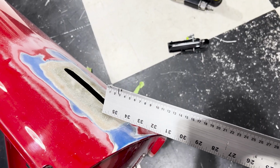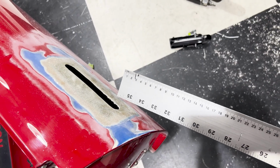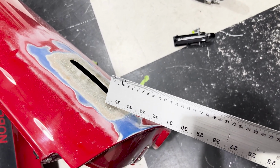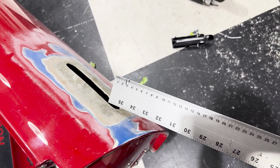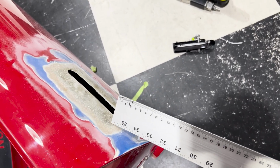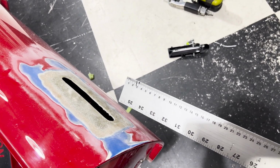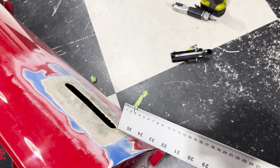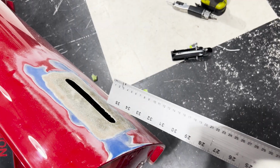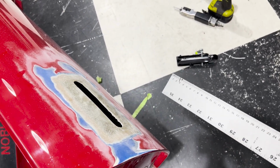So what I'm gonna do is some more trimming. I'm gonna trim down specific areas where those bolts are gonna go through, and I'm not gonna trim it all the way down, but I'm gonna leave a little bit of the back of the bolt on there when I go to set this in place. Then I'm gonna do another layer of fiberglass over those pieces, probably just over those pieces specifically, but that way when I take the handle off, all I have to do is slide the handle back out, and that should work.